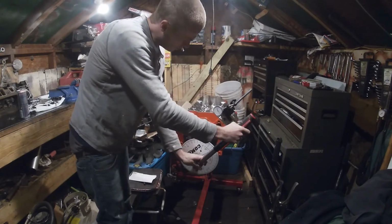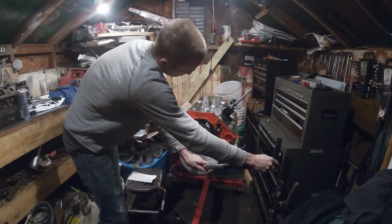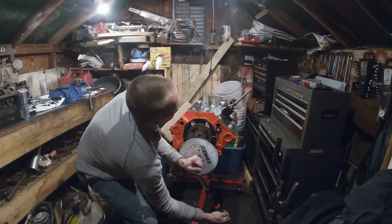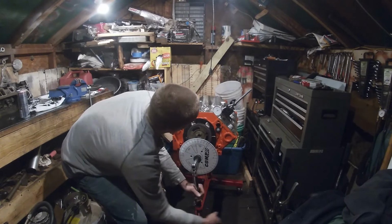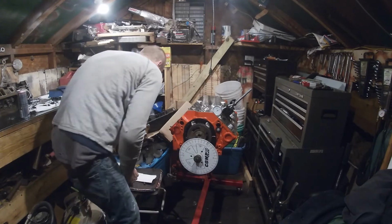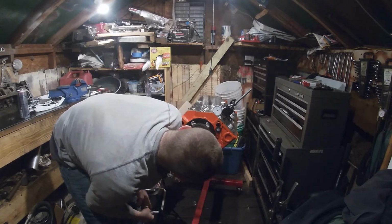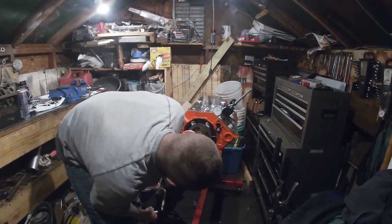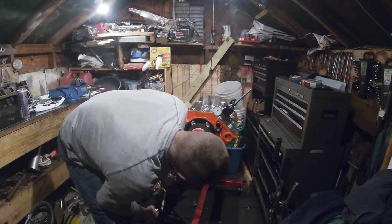It's at max lift. 300. We're going to have to count down backwards, just like we did for the others. 200, 100, 50. Now we're going to have to stop right at 6 thousandths. There's 7. There's 6 thousandths. So 61 degrees after bottom dead center. Right there. There's your 60. Look, bottom dead center. So it's turned around this way. After bottom dead center, because it's moving that direction, it's at 61 degrees.